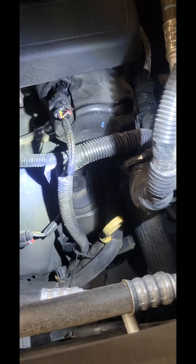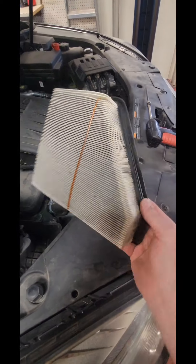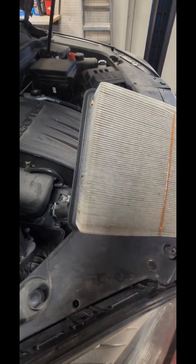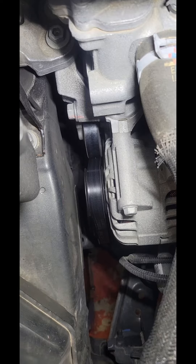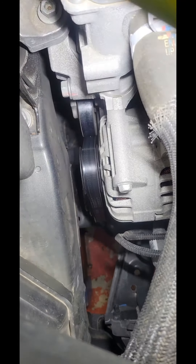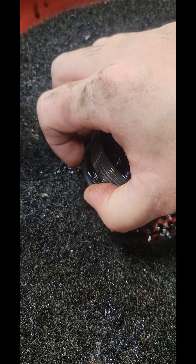Checking brake fluid and coolant — we're gonna add some washer fluid. We'll pull the air box open and check the dipstick, check for any leaks before doing the oil change. We'll pull that and make sure there's actually oil in it. I'd replace this belt — no rust or discoloration, sure it's worn, I'd recommend replacing it. Otherwise pretty clean, no discoloration. New seal every time.